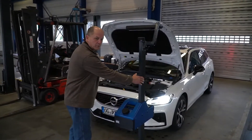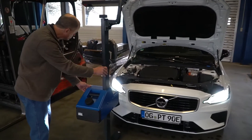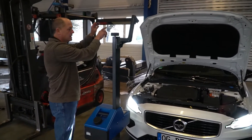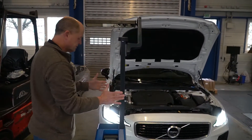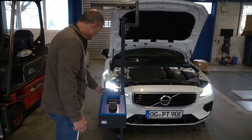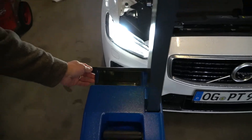When done with one light, move to the other side. The height should remain the same. Re-center it on the light by looking at the reflections — right there is the center. Check for parallelism again using the line in the mirror, lining it up on the shock tower. Confirmed still parallel. Then look at the array through the mirror to confirm the light pattern is still where it needs to be on this side.